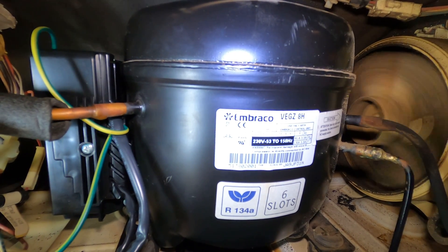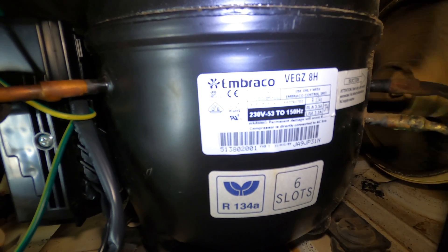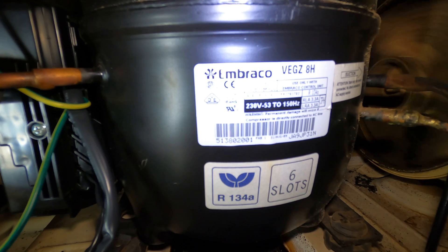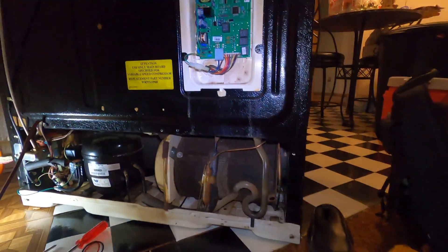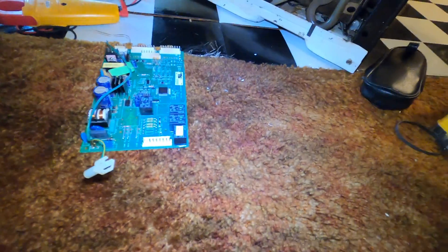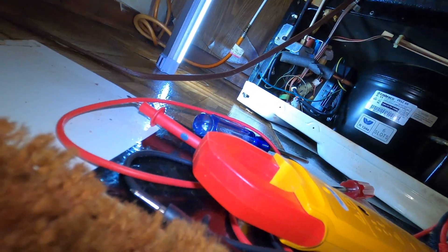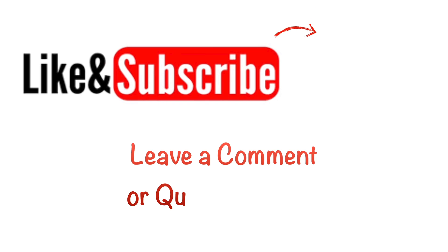There she is — you can hear it rumbling, sounds good! Once you hear that, you know it was definitely the inverter. There's always the possibility of something else going on, like a sealed system leak or restriction — but to check if your fridge is cooling, give it 30 minutes and stick your hand in the fresh food section where air comes across from the freezer side. If you're getting cool air, you're likely good to go. In this case, we needed both a control board and an inverter to fix this refrigerator.